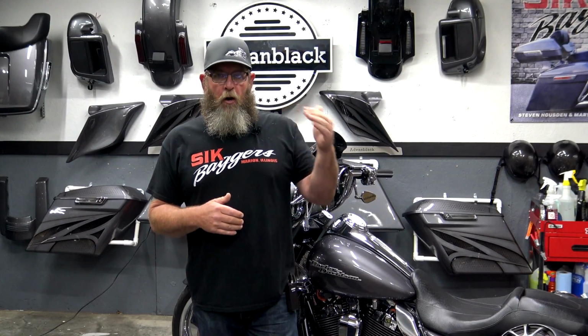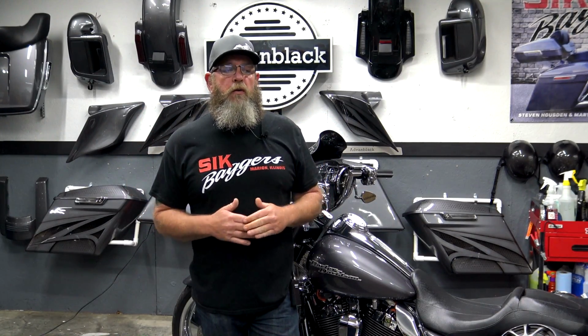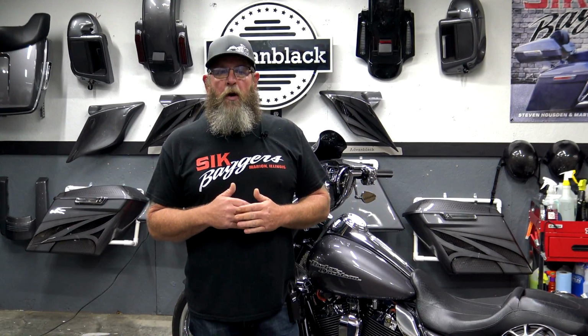So a couple of different codes that you guys need to know about. You've got current codes and you've got historic codes. Current codes are going to display anything that is currently disrupting the operation of the motorcycle. So you're going down the road and something actually happens, you know the bike's not running right or turn signals out, something. You pull over, you pull up a code, and it can generally get you the idea of where it's at. Following that code or multiple codes, it will show you a part number.